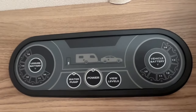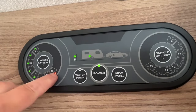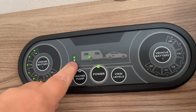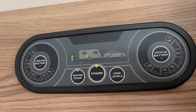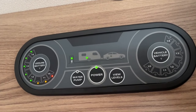Above your door, press your power on — we now have power inside the caravan with mains plugged in. If you press the leisure battery button it will tell you how many volts you have coming into the caravan. If we were to unplug our mains, it would tell us our leisure battery voltage rather than what's coming in. You can also press the view levels button which does exactly the same job.